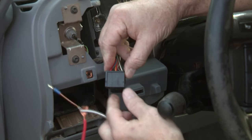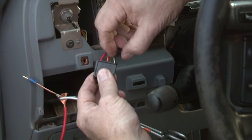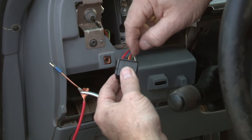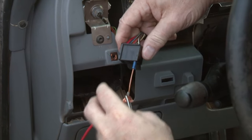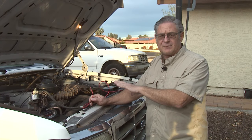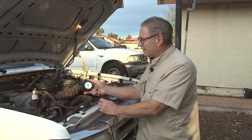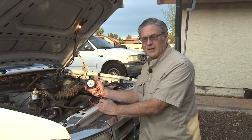The black and white cable is the power wire going to the rear fuel pump, and the red one is the power to the front fuel pump. We're going to bypass those and put voltage directly into the wires going to each tank one at a time. We'll start with the rear tank — we'll plug in a jumper wire that runs back to the battery and make the pump run directly to see what happens. We've also hooked up a pressure gauge onto the fuel rail. This first check is bypassing to the rear tank and rear fuel pump.